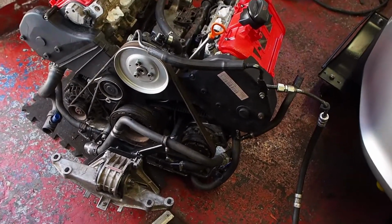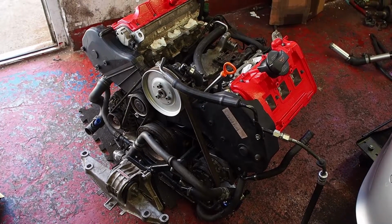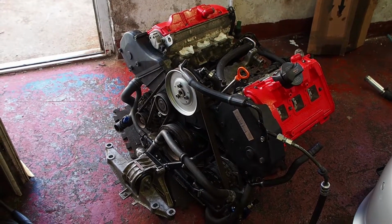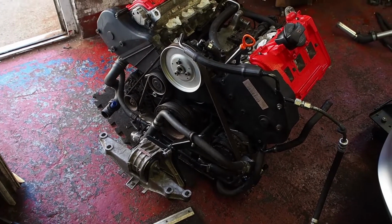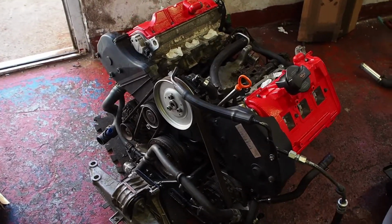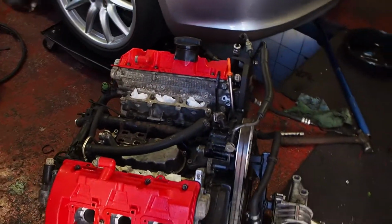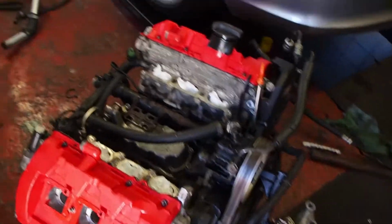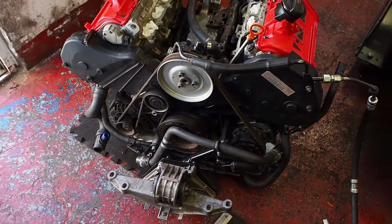So this is the engine all back together now, so in the next video it'll be all the fun stuff, trying to get the RS6 turbos fitted up, make a decision on which exhaust manifolds I'll use. Maybe I'll modify the stainless steel ones I got. I'm going to try the 6-speed gearbox, so I'll bolt that up and then I'll do all my fabrications around that. I feel like it's the best bet, it's the strongest out of the two, and I'm going to be making more power than it was before.